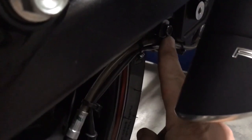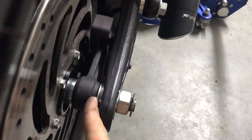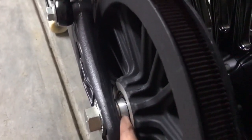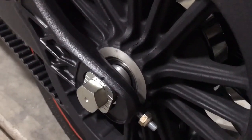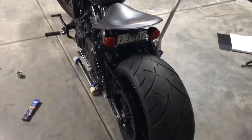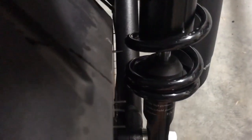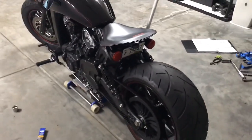Let me do a quick orientation of what we did: there was the 10 millimeter bolt, the C-clip, axle bolt, alignment spacer, thin spacer from RC Components, brake caliper mount, thick axle spacer removed from your stock wheel, the axle spacer on the other side which RC Components sent you — remove your stock one and discard it. On the outside it's the alignment square spacer and the axle bolt itself. Make sure everything is done right. You've got two wheels — there's no room for error. Make sure you've got enough clearance between your wheel and your swing arm — about three-sixteenths to a quarter inch on each side.